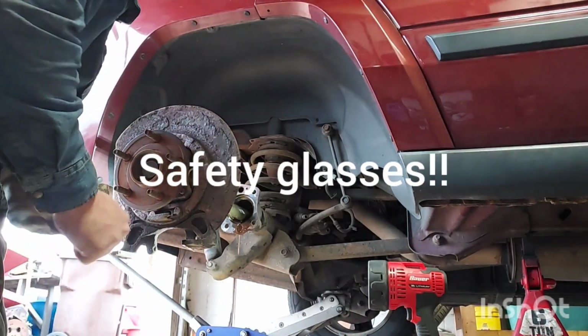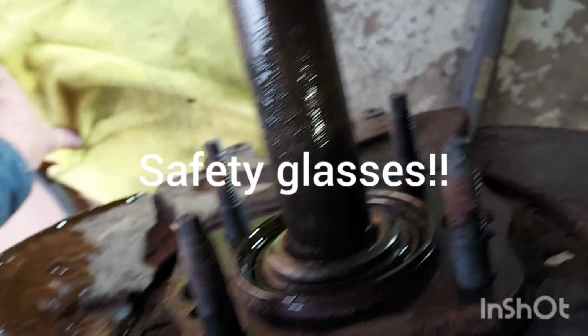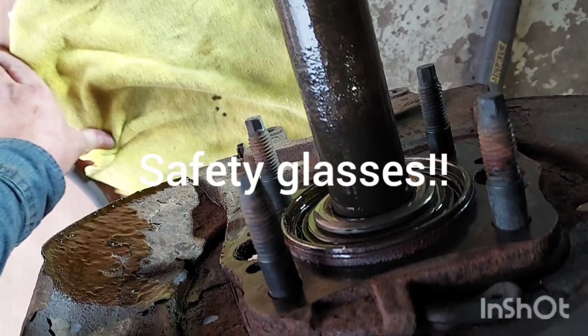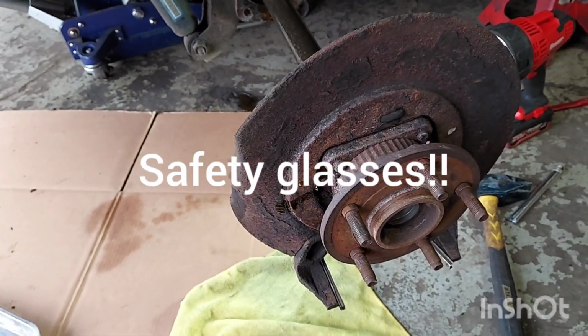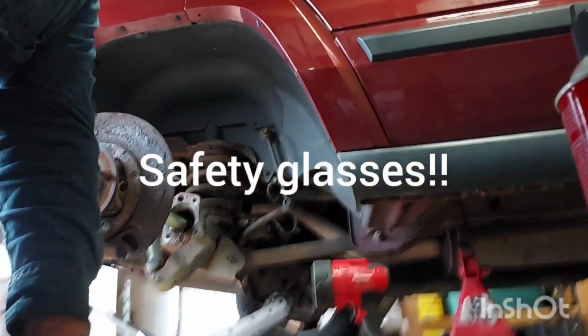I don't know if this axle just slid out of this bearing right here. The splines were showing now. I'm not sure if that's supposed to just fall out of there. I thought that was pressed on. Whatever, we're going to change the whole unit anyway, I think. Quite certain. But it's a press fit bearing. I'd have to watch the video again. Anyway, let's see what happens.